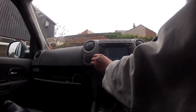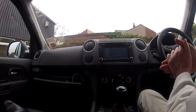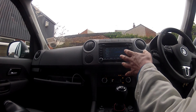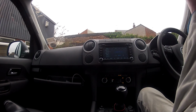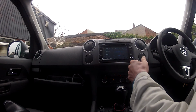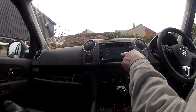I did have a fault this morning, which is strange. I went a little drive up to the other end of town, got back in, and the radio didn't come on at all. I tried doing a long press on the volume button, a short press, turning the ignition off and on, just nothing. I knew there was power to it because that little fan that I just mentioned, I could hear that running in the background.